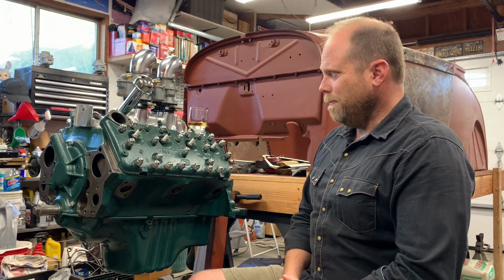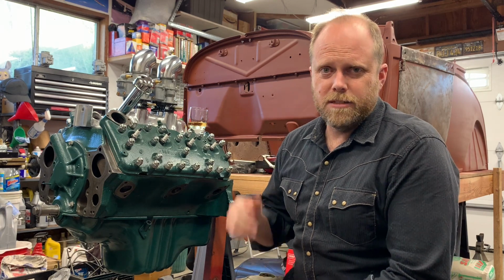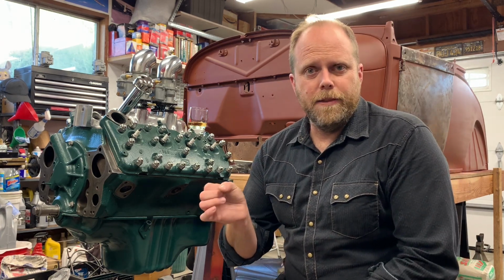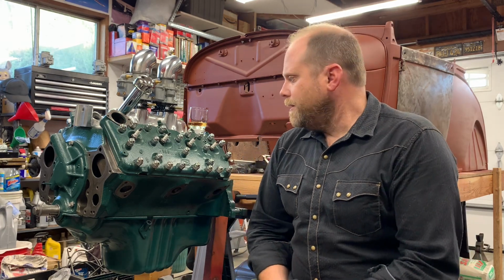It also has, in my mind, a slightly superior valve train. I don't know how the weight of the adjustable lifters really affects performance and revving, but this has the hollow Ford non-adjustable lifters, and valve clearances are set. Basically dot everything in on the lathe, and then it's running lash caps to get a nicer, fatter footprint on that Ford OEM lifter, because they are a little on the thin side. It's got Isky's springs that are matched to the race cam, so it should be good.